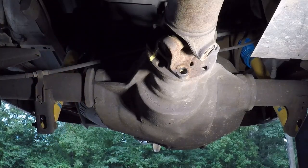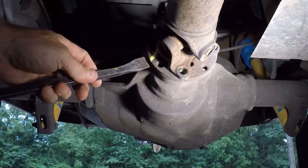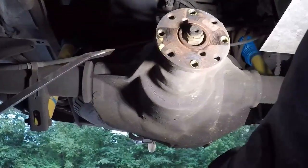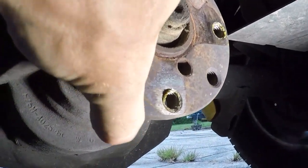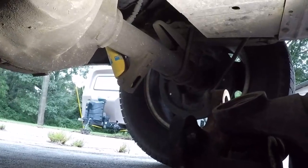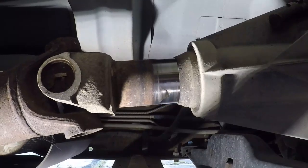Well, that's a bit stiff. Let me grab a pry bar — and yes, this is an actual pry bar, not a screwdriver, although I'm certainly not averse to using a screwdriver. You can see there's just a little bit of a hub-centric fit there; that's why it was hard to come off. But nice and clean, nothing too terrible. Let's check the u-joints out. Smooth as silk — nice thing about having effectively no torque on it. The other one feels pretty good too. It doesn't feel bad, that's for damn sure.